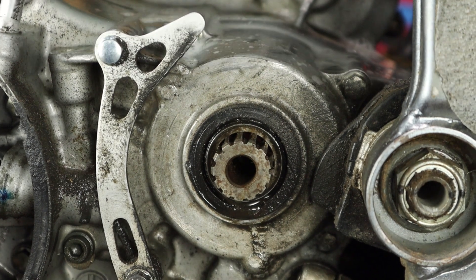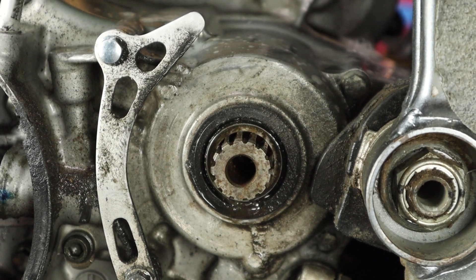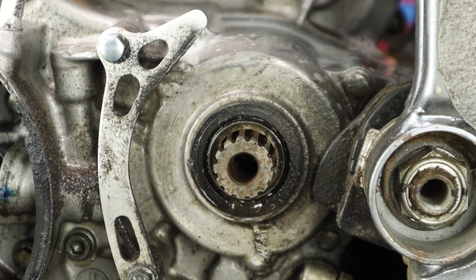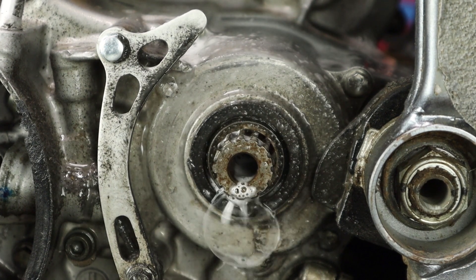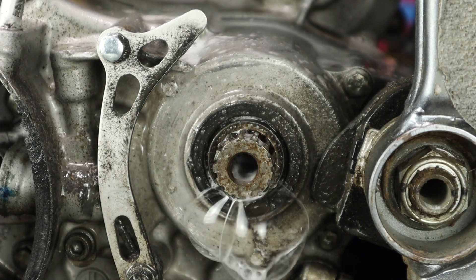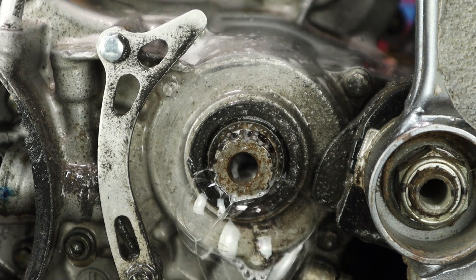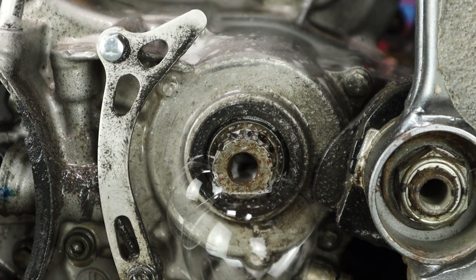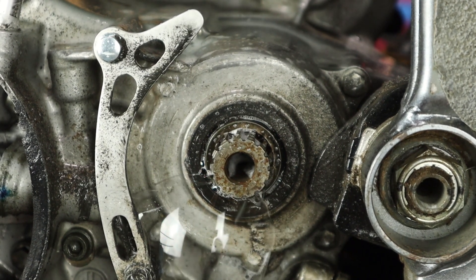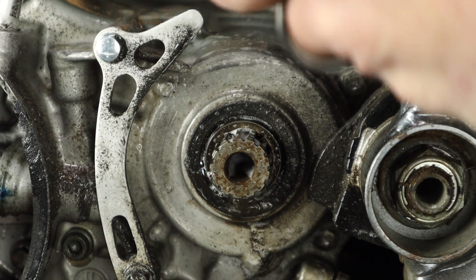Sprocket's off. We're going to go ahead and pump it up and give it a spray. And we have air bubbles coming out from the bottom of the output shaft! So that means it's sucking air from the sprocket. I've never seen that or expected that before — it would be sucking air from there. You can hear it, but why would it be coming from there? Say hi to Blaine, everybody — he's helping me pump this sucker up.